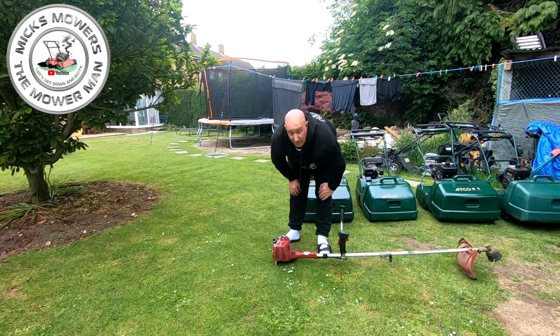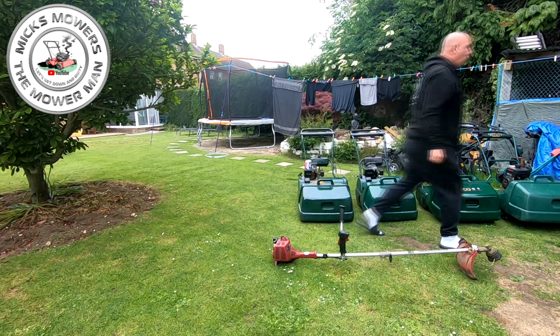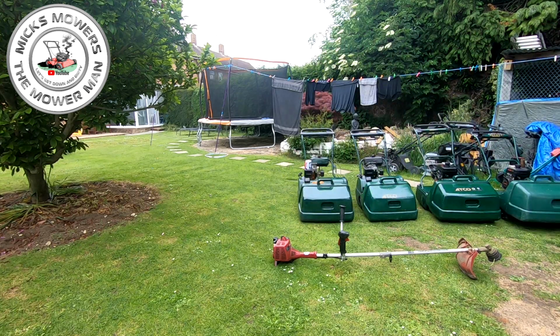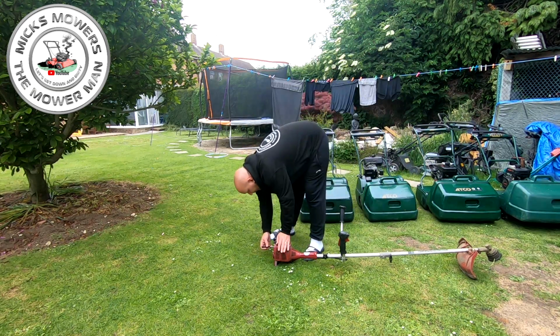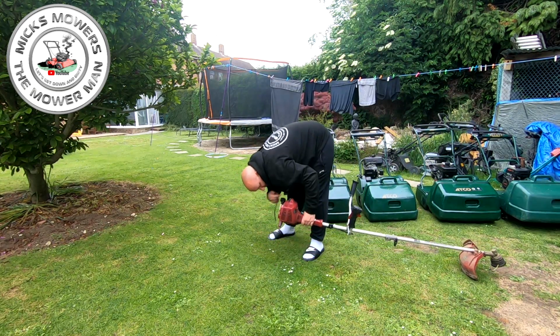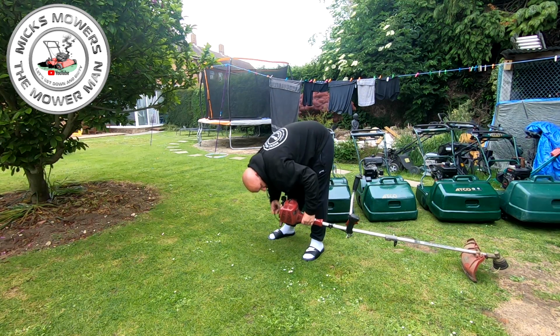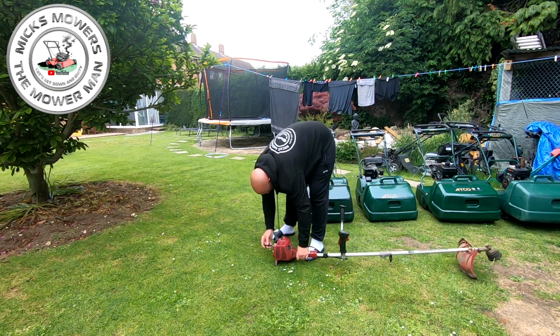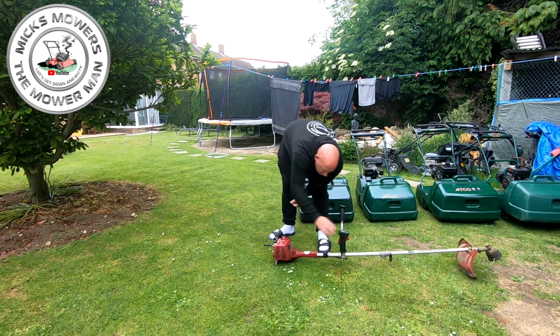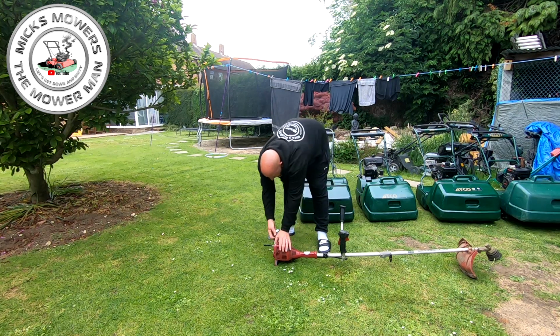I'm going to try something before we even put this on the bench. I'm going to grab my little Pac-Man tuner. It might not be dirt in the carb. It might just be, literally, the diaphragm has changed in regards to flexing, and we might be able to get away with tuning this. Apart from the simple fact they put the tuner right in the way of the fuel tank. God, that's a thing, isn't it? I think we got it though. Right, so I'm going to literally just try and tune it first off.